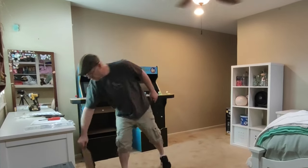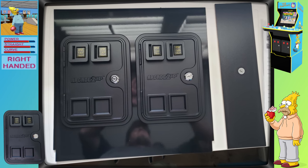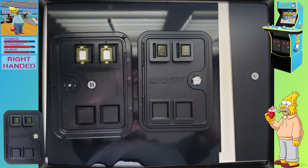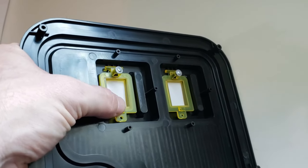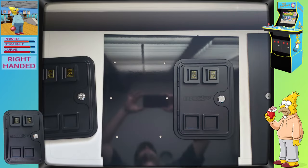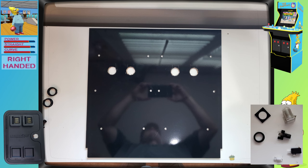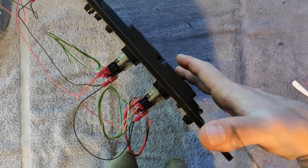When I built my second stock Simpsons cab, I purposely did not install the front panel and took it to my garage to figure out how to make the stock buttons work. When piddling around with the coin doors, I saw that the coin buttons looked as if the original design may have used working buttons, and the coin button inserts could be modified and made pressable, as the top of each insert has a half hinge keeping it in place. All I did was remove the bottom screw completely, back the top screw out as much as possible, then secure it in the screw hole with some common modeling glue.